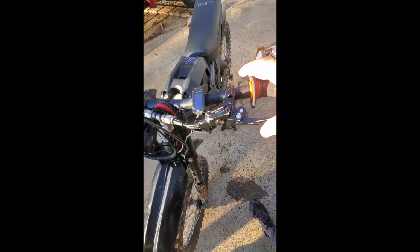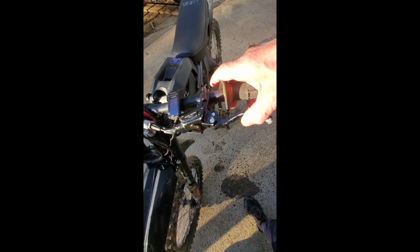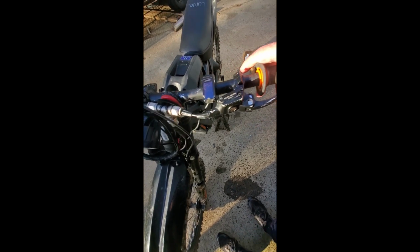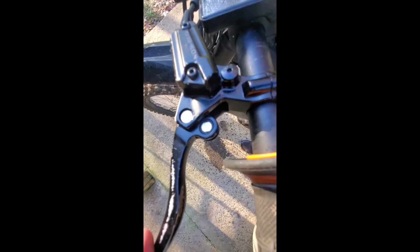just on off. But separately I can control the rear brake by force, which is how our brains want to think about braking, which is how hard am I squeezing. Harder I squeeze, the more regen I get. Force modulated braking based on hydraulic pressure in the rear brake lines. That's Hydregen. Now with the rear caliper installed, we'll get a combination of hydraulic and regenerative braking.